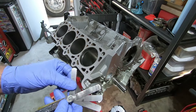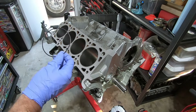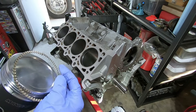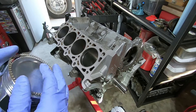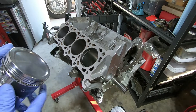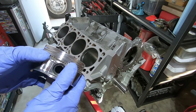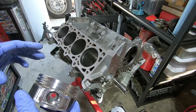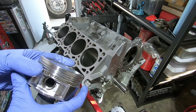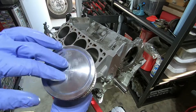That one stopped at 26 thousandths, so I'll write that down. With that ring measured, I'll go ahead and measure another oil ring the same way. With the oil rings measured, we can go ahead and start putting the oil ring on — you're just going to spiral it on there. Make sure it's not overlapped; it should have a little gap where you can spread it apart. I want to make sure it's butted up against itself properly.